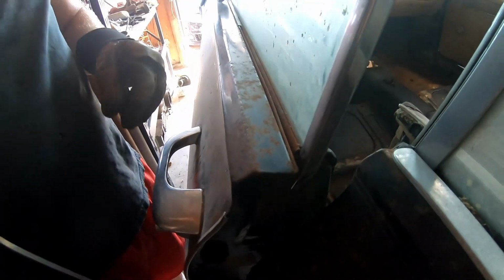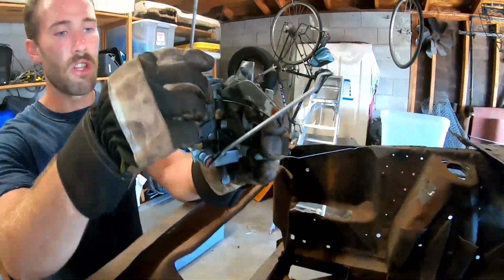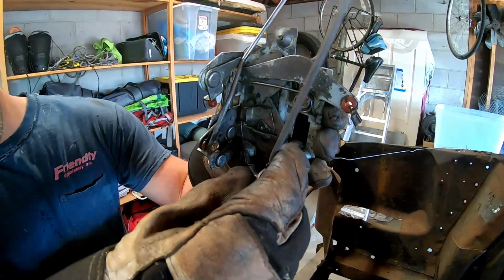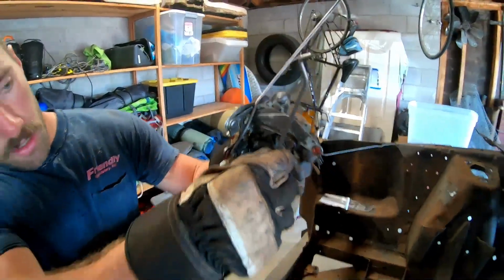right here. You stick it down. I can show you on that side actually. You stick the rod down this slot right here. You make contact with the mechanism down there. Obviously you can't see down there because it's too dark, but when the door is locked, this thing right here, I believe they call it a pawl, is up. When you unlock it, it goes down.